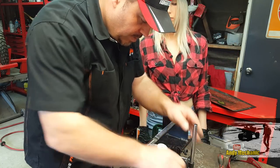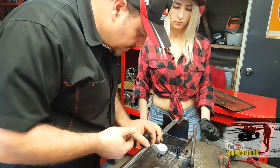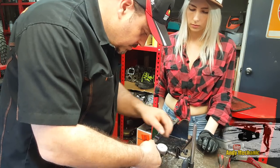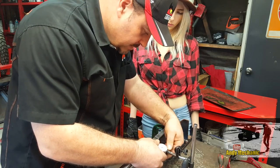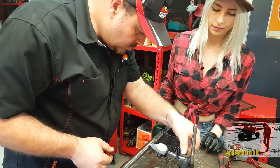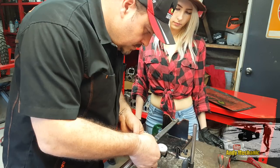So we'll turn on the magnet. That's not going to go anywhere now. We've got to make sure we've got movement up and down, and we haven't. See, it's not moving at all. The needle's probably a little bit above the rack, so we need to just twizzle that down a bit. And we can do that, really posh, by turning this. So we put it on to say about there. And then we've got movement both ways.